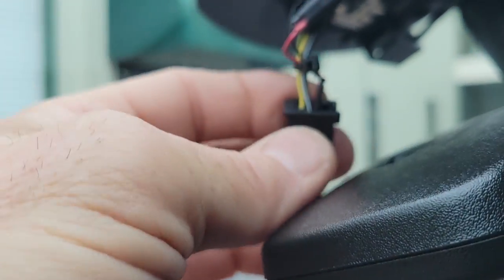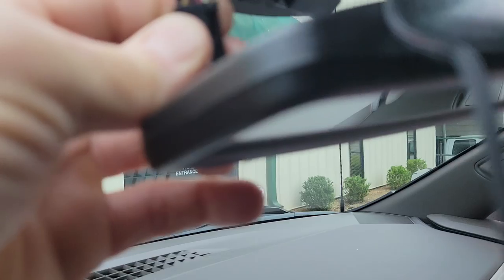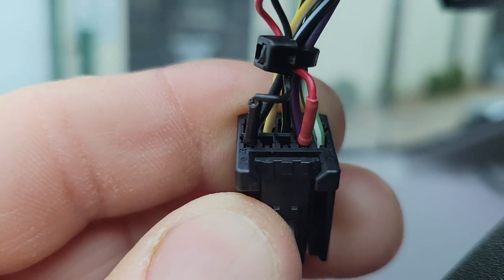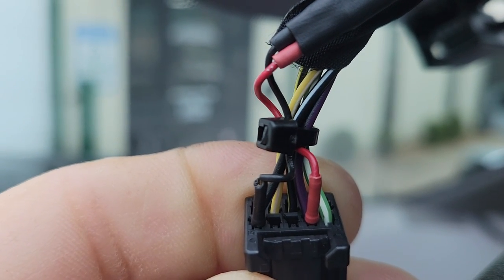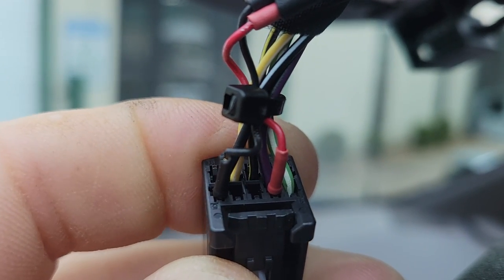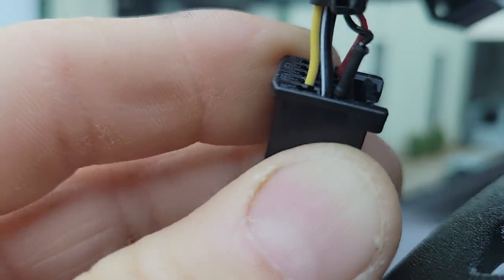Where you put the red and the black wires from the PosiTap. On one side of this there is the green with a white tracer and a purple wire. The purple wire is your switched 12 volts — this is only when the truck is running, not in the accessory position. It's stupid to have your radar detector on while you're sitting still, so this will only power it up when the truck is running.